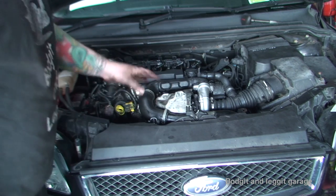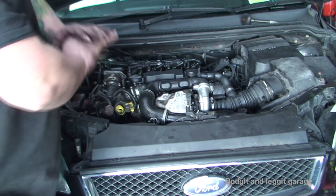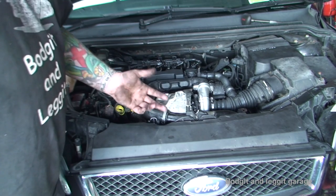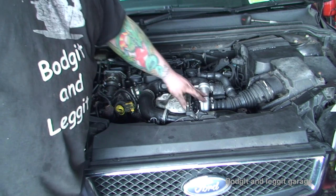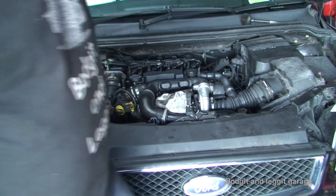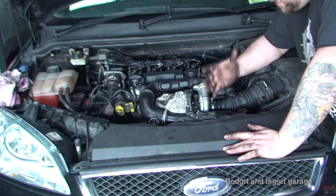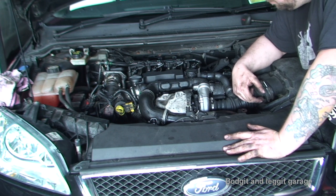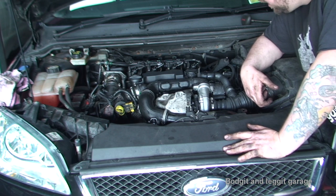As you can hear there's no rattling, there's no scraping noise. You do not want to rev this - don't even attempt to rev it or drive it. Let this heat up first to full temperature before you even consider driving it. That will allow it to get plenty of oil inside the turbo. You can also double check to make sure nothing is leaking and that everything sounds fine. I'm going to let this heat up properly and fingers crossed let's hope nothing's leaking or loose.